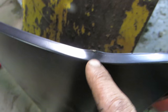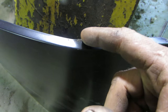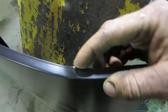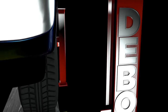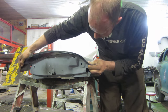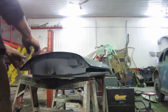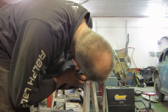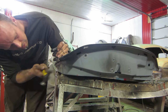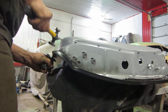The GTO has an extra body line going down the bottom of the door, and it looks like on this repo skin they didn't shrink the steel. So I'm just going to cut it so it'll follow the inside of the door rather than fold itself straight, because that metal isn't shrunk. Once you're happy with the inner half of the door, it's as simple as laying the new skin right on top. It has the edges folded over at 90 degrees already, so make sure all four corners are folded over right and sitting in the right spot. Work from one end to the other folding that last 90 over tight — don't do it all at once, but go up and down the door about ten times, holding it a little bit as you go.